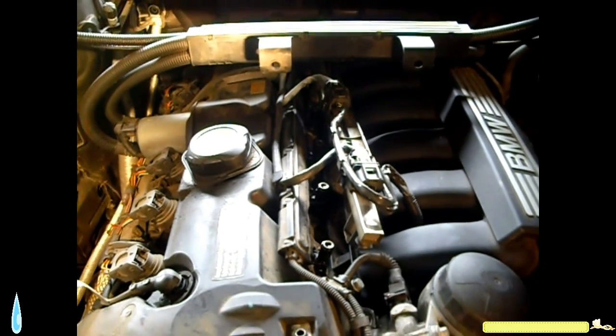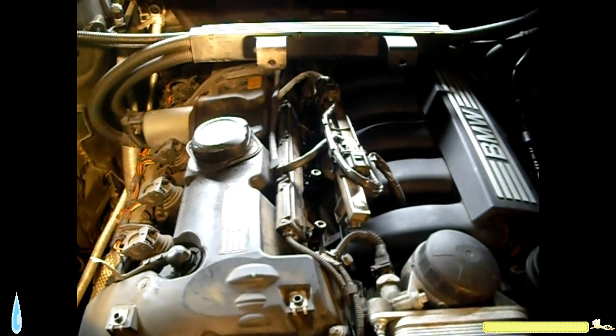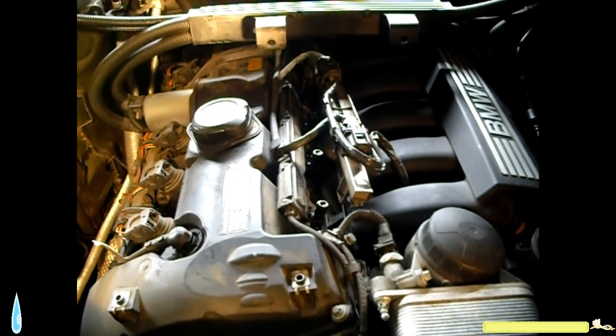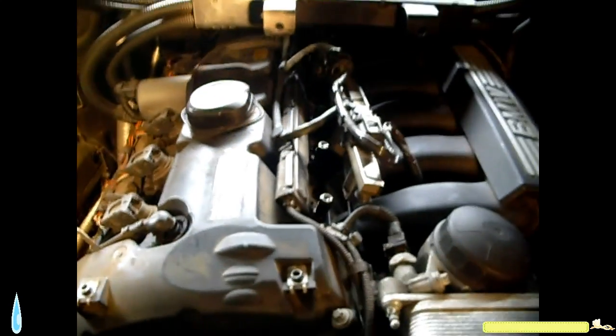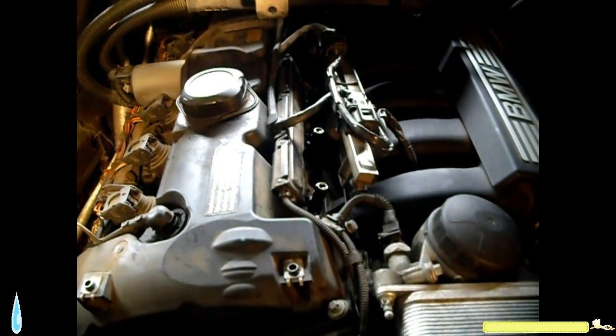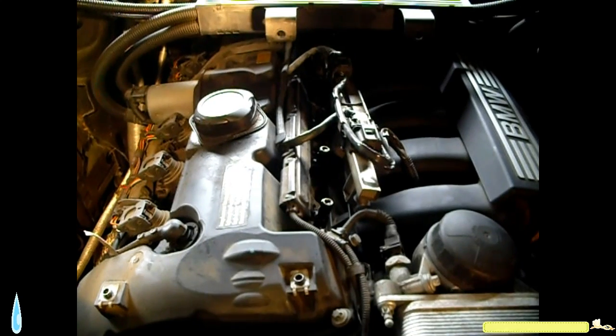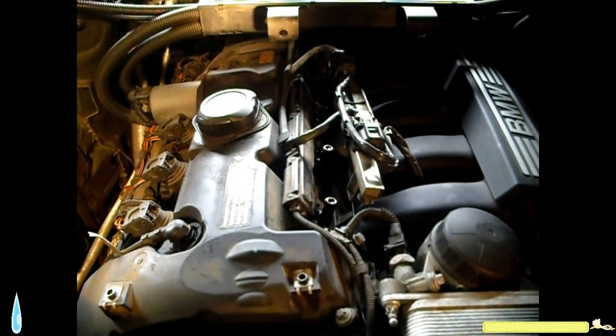It's blurry, but you can see the O-ring is damaged. So I'm going to replace that O-ring. Then I'm going to lubricate each and every one of them with grease before I put it back. The O-ring I should have around 4 o'clock this afternoon. It's morning time, but I'll get it ready.